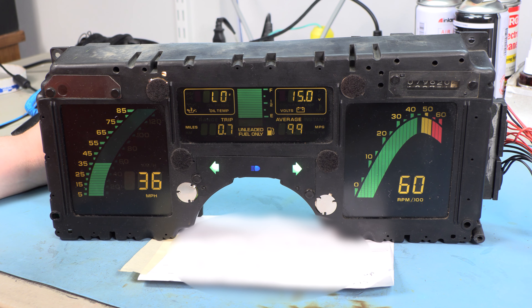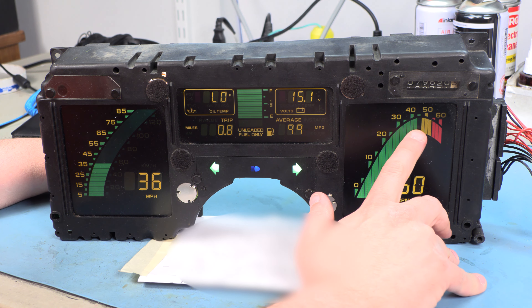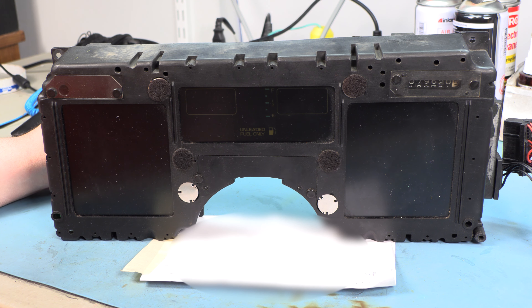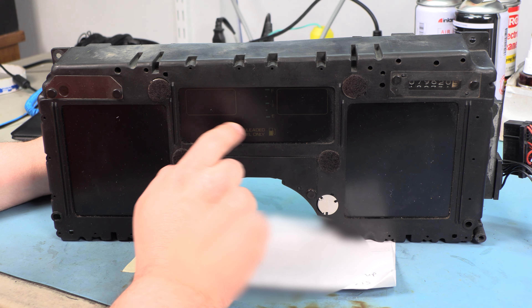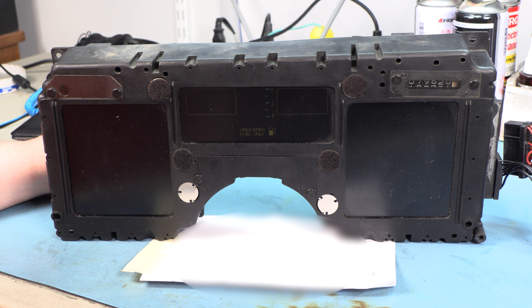When we plug it in, what we see is issues with the tachometer LCD — this segment is not lighting up when it should. It is properly measuring speed and tach signals. The LCDs are entirely readable, so I don't see signs of polarizing film fade. With the key off, all three LCDs are black. We do see some signs of the filter and unleaded fuel markings, but that's perfectly normal — not a sign of faded polarizing film.